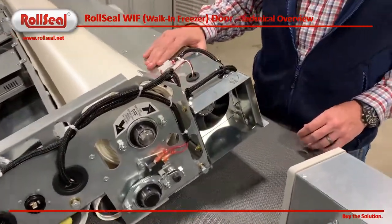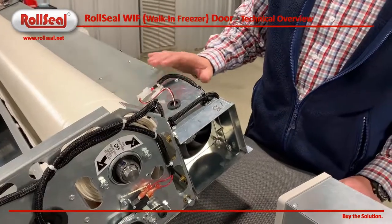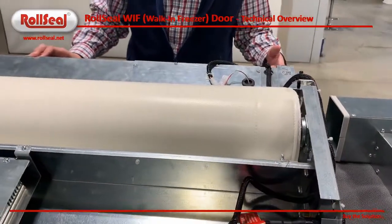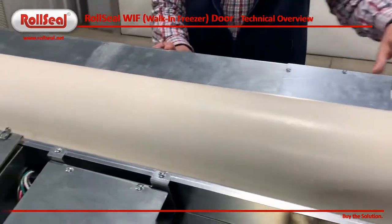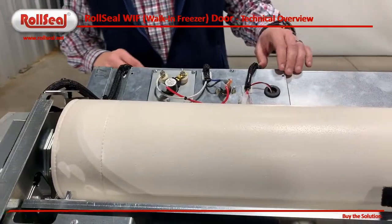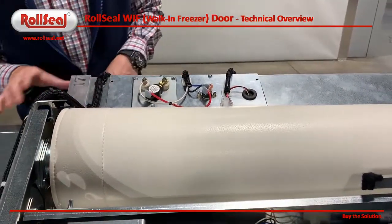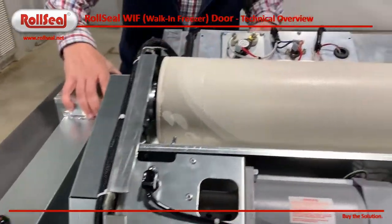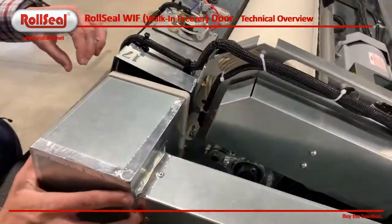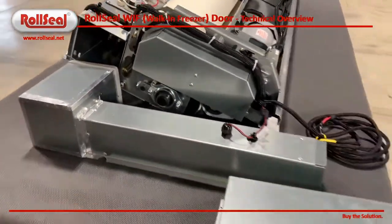Moving up, we've got our fans mounted — you can see in here. This is specific to a freezer door. I've got a fan on both sides of this top duct. I've got what we call the return fan. The air is transferred through these ducts in a counterclockwise rotation, so I've got my return fan, and then I've got a supply fan mounted the same way on this side. These fans allow the air to transfer through this top duct, then through these corner ducts, and then down the tracks. The corner ducts will be attached with this strap you can see here — this will be removed upon install. The corner ducts will go in, the strap will go back on, and this is what will connect the ducts to make it a continuous system.